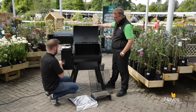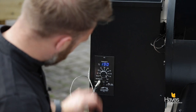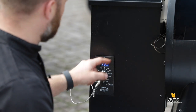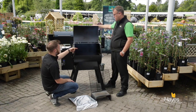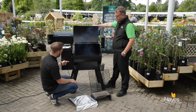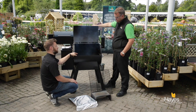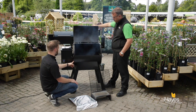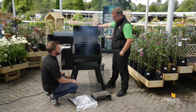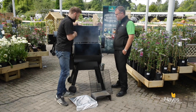Let's say we're going to do a roast - I'm going to go around to 190 degrees. We've got 190 flashing on the display. What's going to happen now is we can see a little bit of air movement coming out at the bottom of the chamber. The onboard computer has an air fan pushing air through to the bottom of the fire pot, and we've got the corkscrew auger taking the pellets along into the bottom of the chamber.